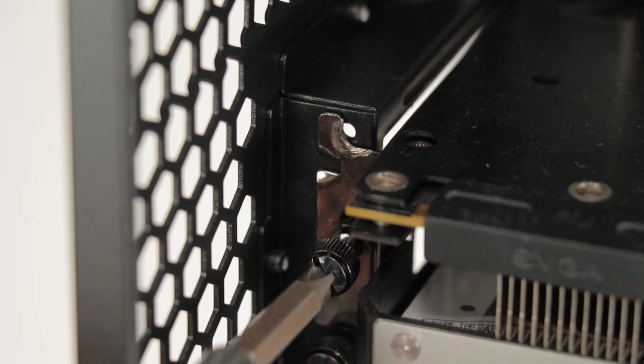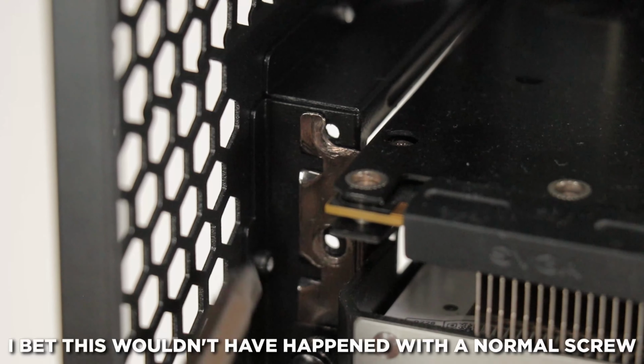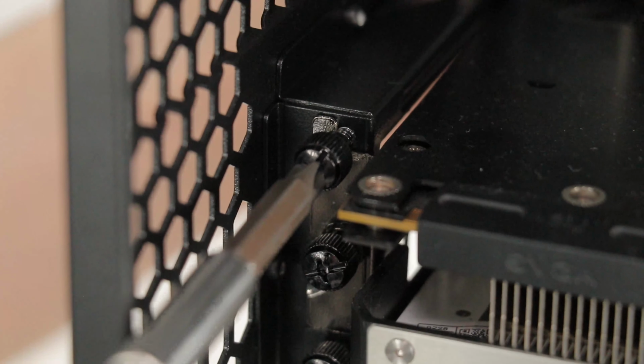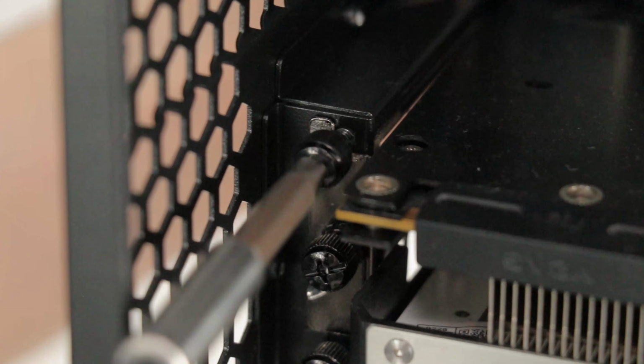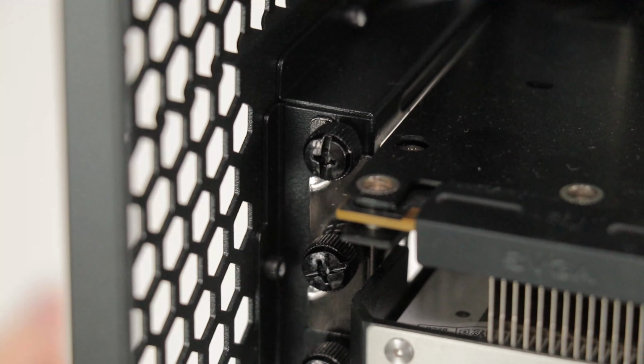The lack of alignment is just manufacturing tolerance and depends on so many factors, like the holes drilled for the motherboard screw positioning, the bending and forming of all the panels, and even user-induced tolerance for how the board is sitting on the standoffs when you screw them down, which is reduced by the standoff, to be fair, so it's not your fault. And the fact that it requires a fair amount of force to overcome actually speaks well for the rigidity of the chassis as a whole, whereas rear panels in less rigid cases can be flexed into place with just your hands.